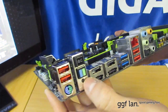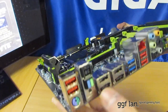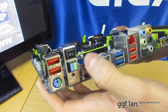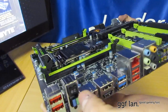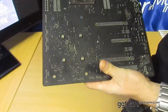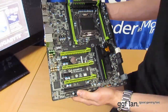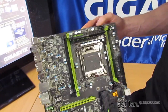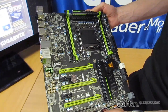On this little header, the first small round button is your clear CMOS — I like how it's a small button so it's not easily hit accidentally. The purple and light green button is your switch BIOS, so you can switch between BIOS 1 and BIOS 2 if something happens. The button above that is your OC button — you can have predefined settings in the BIOS and boot with OC or standard mode. On the back there's the X79 back plate with some extra screws to hold in the heatsinks. The CPU 8-pin power only needs one connector.